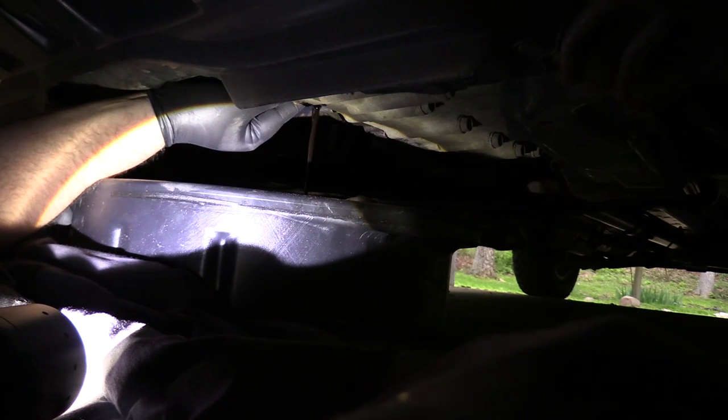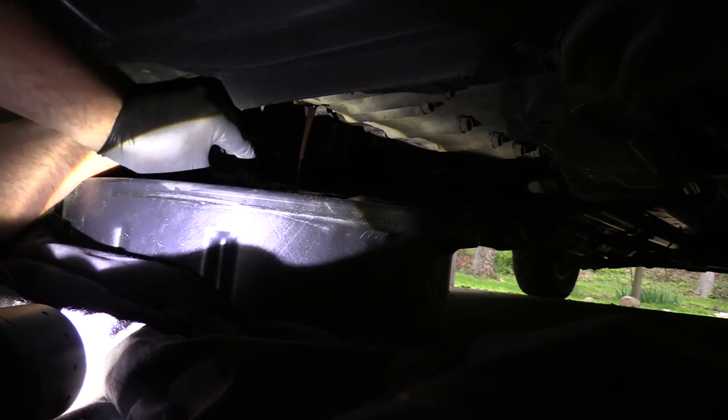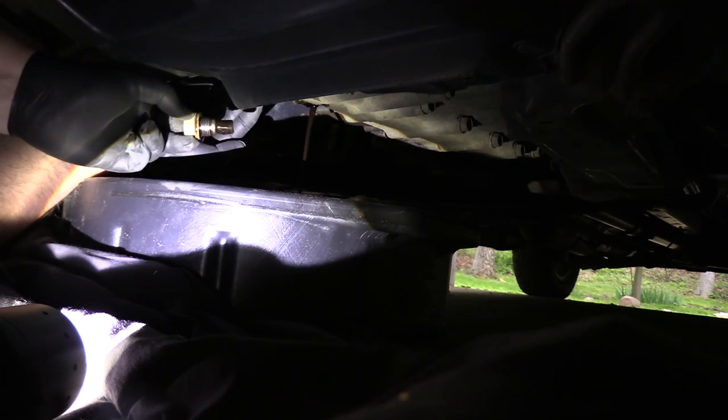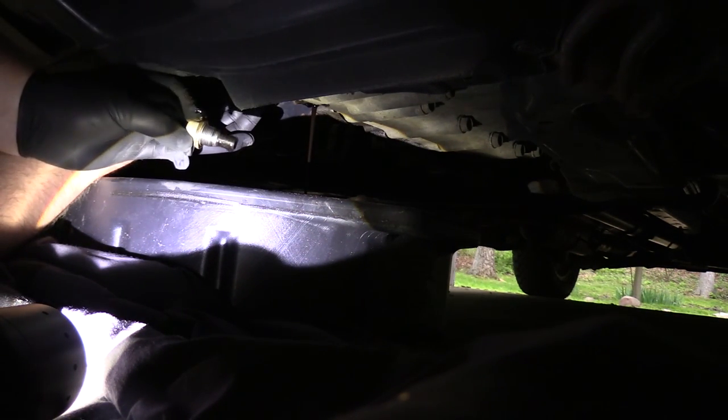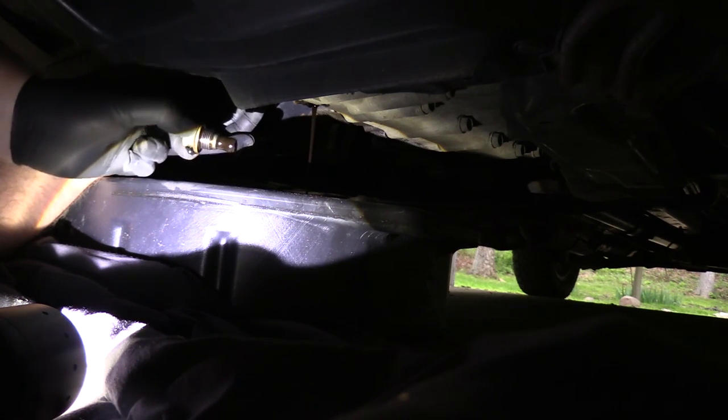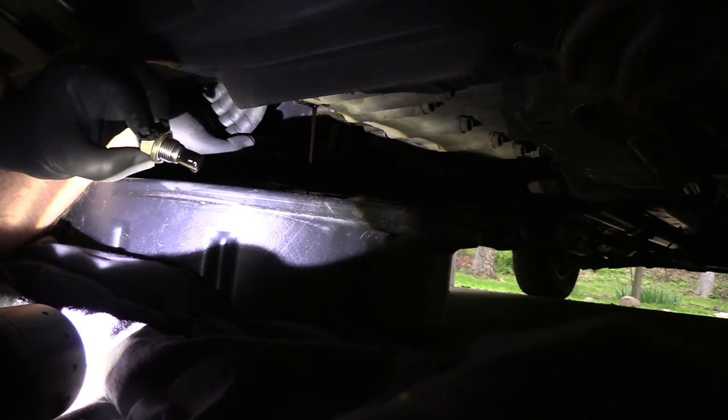You can see that's pretty dirty. The fluid itself is that sort of Honda enclosed machinery red — like a red ale. At the end of this drain plug you have all this weird sort of muck. Those are little metal shavings from the transmission. I don't look like I have too many, which is a good sign.